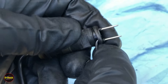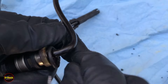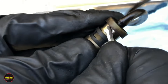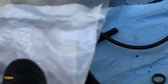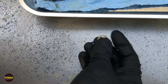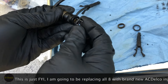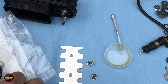When doing this shroud-replacement rebuild, we won't just replace the O-rings — we'll also take off the top O-ring, bringing it over the top since we have the shroud off. We also replace the retaining ring: use a small flathead screwdriver to get it off. In the kit we find the larger O-ring, the smaller O-ring, and the retaining ring that goes on top. You slide the O-ring on, snap on the new retaining ring, then work on the lower O-ring, and put an aftermarket poppet shroud on to reuse the injector body. Since we're not reusing them in this case, those parts are for something else.